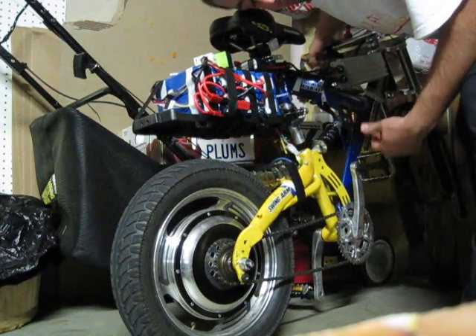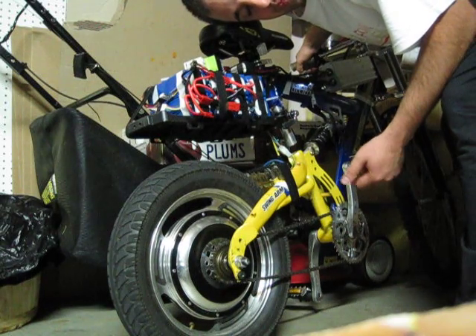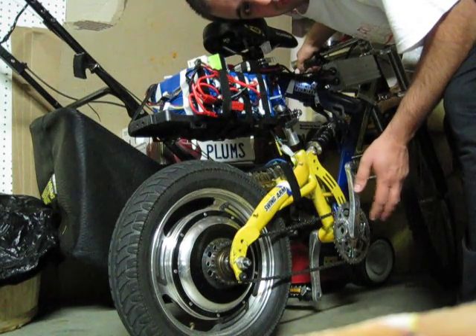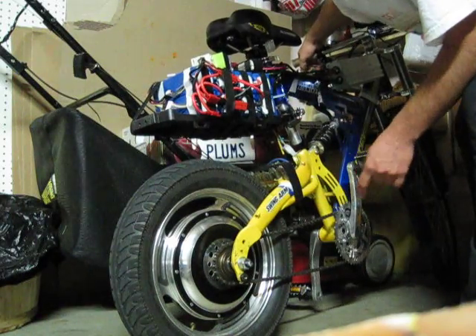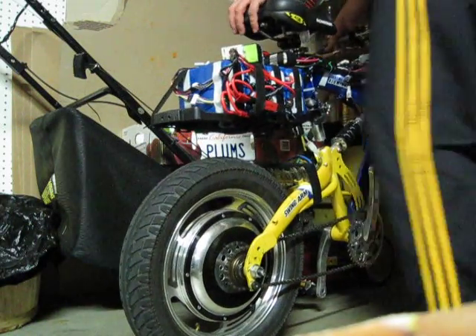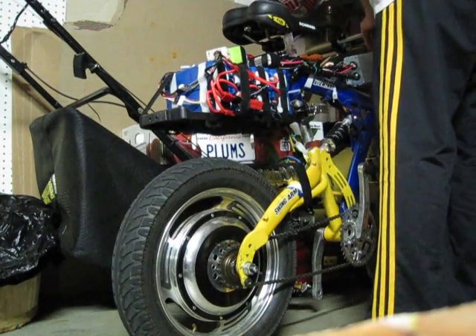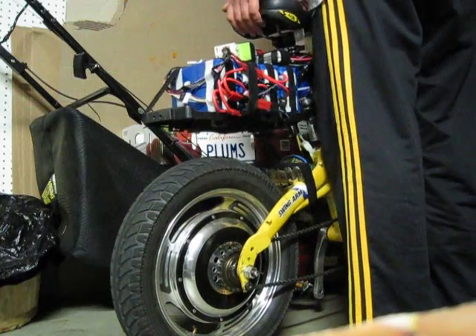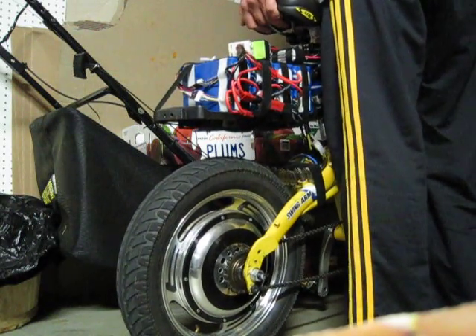Just so you know, star mode and mode 2 did 67 kilometers an hour for me, and about 128 in delta mode. I kicked the relay a bit too fast — if you noticed, I could have damaged the controller but I don't think I did. This is the lowest speed setting with factory settings — star mode, then delta.